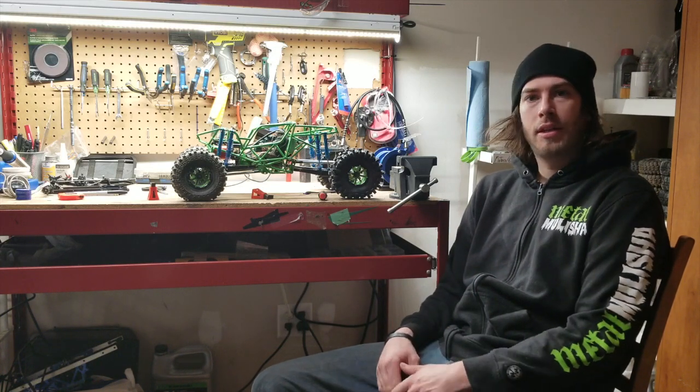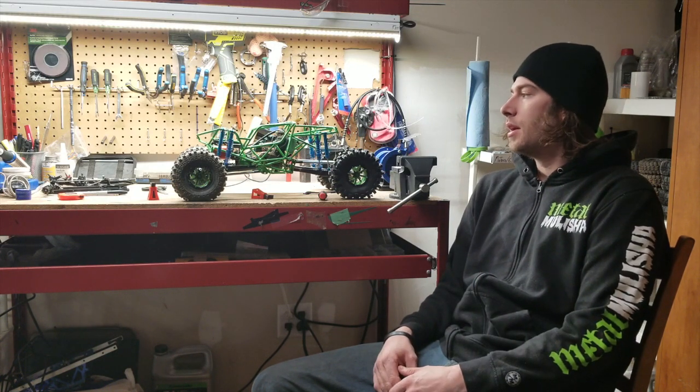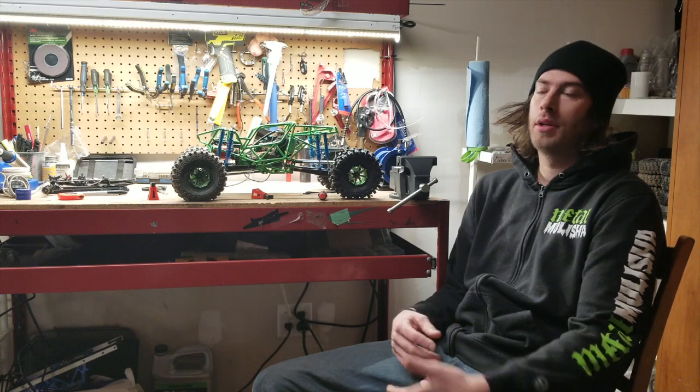Leading arm, great question. So the first chassis I built was Buck Wild, that I used leading arm. The shocks I ran were 95 mil, I think, or similar. So they were a little small. I just wasn't able to get as much travel out of the chassis with my motor geometry and things like that. So this one, where I went 120 mil shocks and leading arm again, I had to bring a lot of the stuff back. Big fan of leading arm, it just allows you to hit stuff way harder, I find, in my opinion, and not really have the same reaction that a shock-on-axle buggy would.